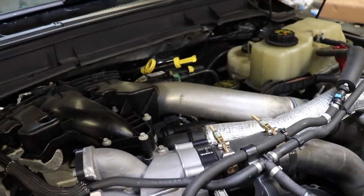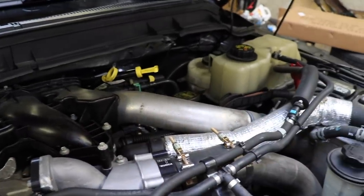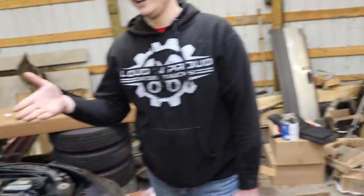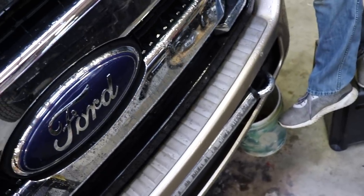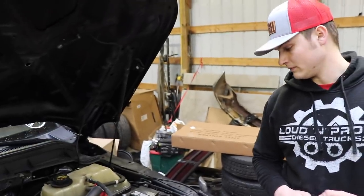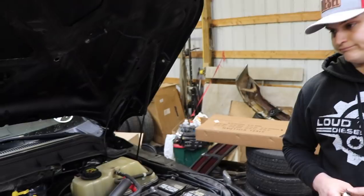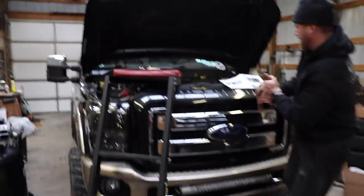The next step once we get the plastic manifold out is basically just prepping it — getting all the old stuff out so we can put the new shiny black pieces in. Just taking out the air box opens up the engine bay; you don't realize how much of the engine bay is just plastic intake stuff. We also had to drain the coolant — there's a slight coolant reroute involved. There's a little valve underneath on the driver's side, basically straight below the headlight on the back. Just loosen that up, drain into a bucket, and then we're ready. Also due for an oil change, so how convenient is that.